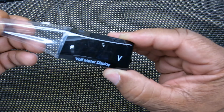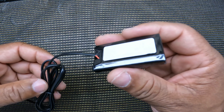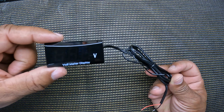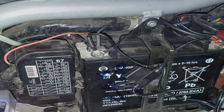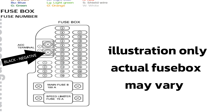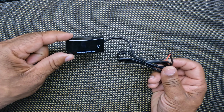I'm going to peel the tape. This particular digital voltmeter came with two-sided tape, peel and stick. You can place that where you want on your motorcycle. The installation is very simple. If you're going to be installing this on your Honda Goldwing, all you need is a power source. A great power source would be in the fuse box located to the left of the battery — connect the black to the negative and the red to the positive. You don't want to connect it straight to the battery because the voltage gauge will remain on at all times and run down your battery. You want to make sure you hook this to a key source.